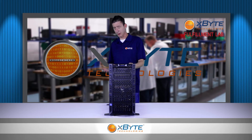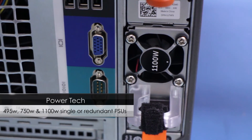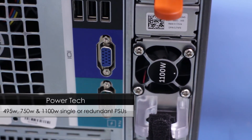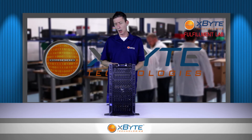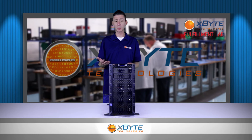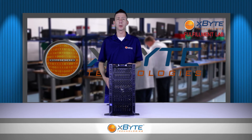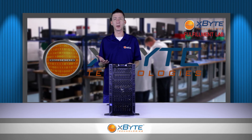With the power supplies, it uses Dell's latest 12th gen PSUs that can come in either 495 watt, 750 watt, or 1100 watt, so that you can tailor it to exactly how much your system needs. A good rule of thumb is if you're going to be upgrading or maximizing any of the three main components — CPU, hard drives, or RAM — you probably want to go ahead and upgrade your power supplies at that time too. There's nothing like getting new toys and not being able to use them because you don't have the power.